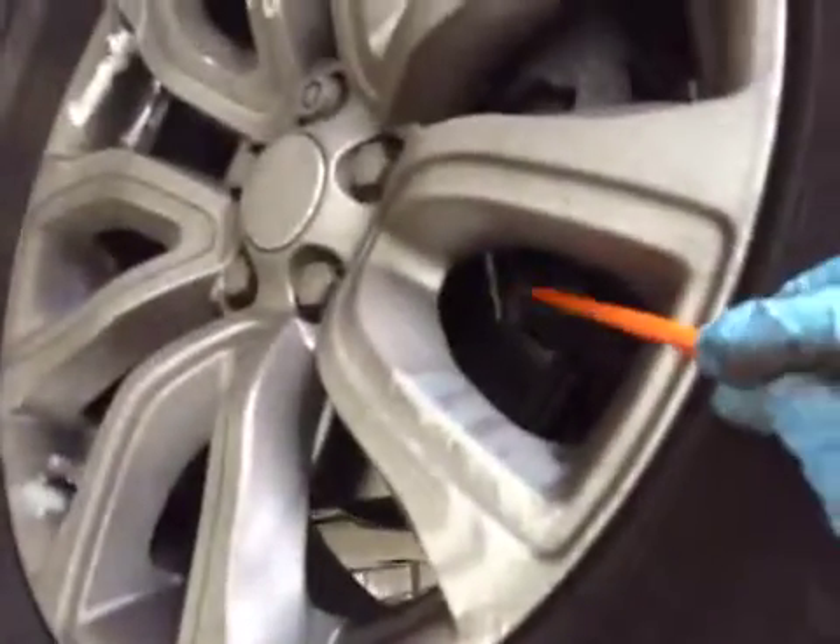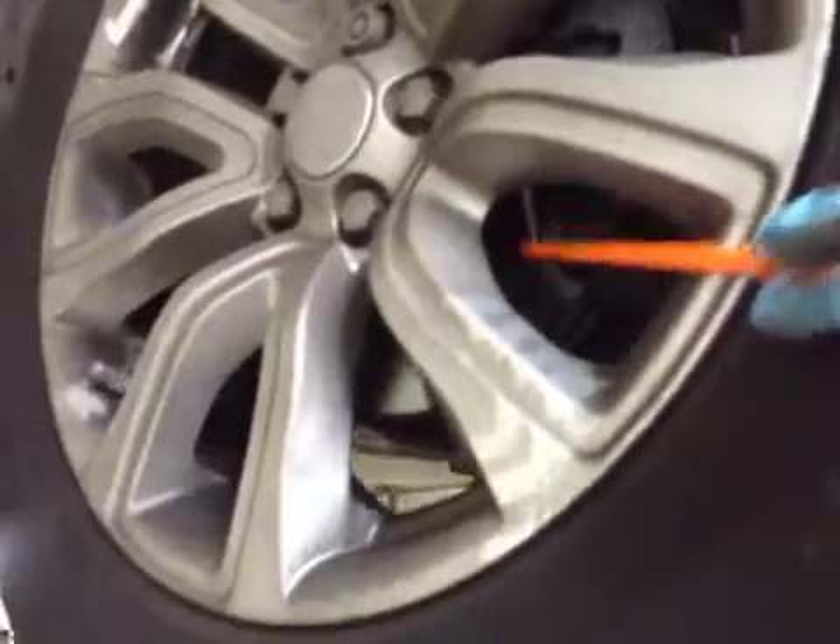Front disc is in okay condition and your front brake pads are on 8mm, so the pads are green, disc green, tires green. Underneath the vehicle, all the exhaust system and all out to the rear of the engine is all looking okay. We go back towards the rear of the vehicle.